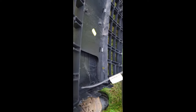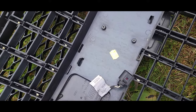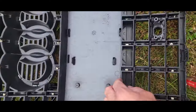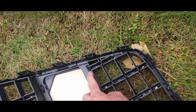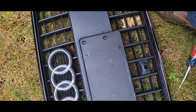I just gotta undo this wire for the adaptive cruise pre-heater thingamabob in here. Now that that's disconnected, these just hold on by these little tabs — going to pry these tabs out to get this front plate off. Behind my plate there are these four screws to loosen it up.